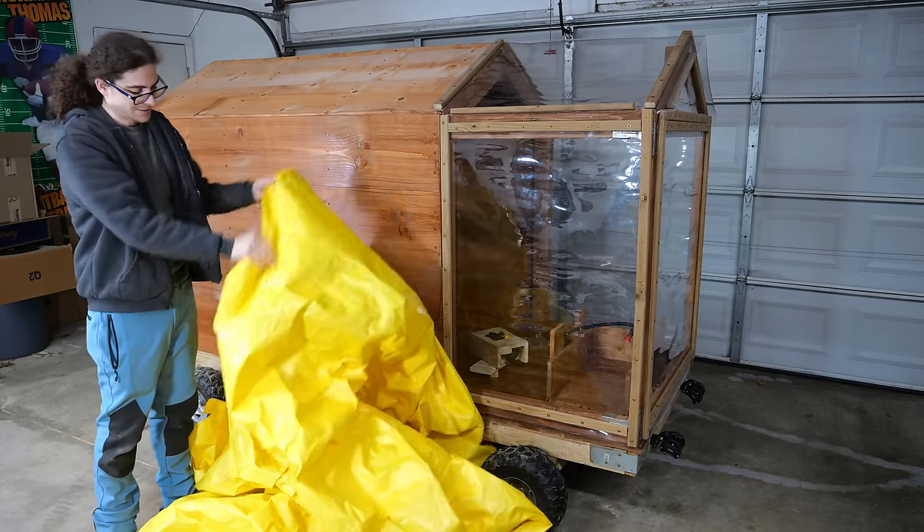Walking around this thing, I still feel like it's missing some stuff — some really nice windows. So I ended up getting these. These are like port windows like you'd find in a boat or something, and they open and close, actually made out of glass, and they have a nice seal around them. I ended up getting two of them. The way I plan on installing them is using the biggest hole saw I have ever used. I take out the tape measure, mark exactly where I wanted the window on the side, pull out the safety gear and the big drill, and just go for it. I lined it up with the hole and just began to drill through it — honestly, these hole saws are absolutely terrifying to use. But they left a really nice hole. There's also a small little registration point on the window, so I have to take out a jigsaw and cut out a small little notch as well. And I can slot in the window and it fits like a glove.